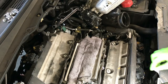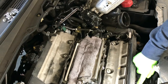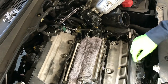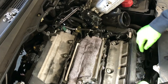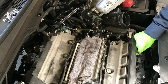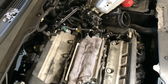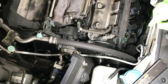Next, I'm going to disconnect the spark plug coil wire harness. Just push on the clips and pull it out. Then we have this connector for the pressure switch — just remove those so that we have more slack and more space to take the valve cover off later.